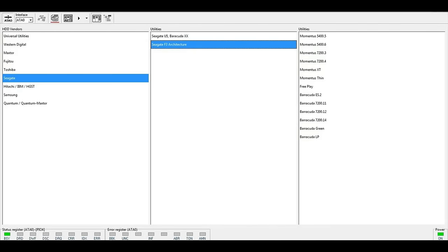Now, it's not unusual for this drive to behave erratically after this process. Also, there's an unknown because of the drive being opened by the client, and also the unknown of how the read-write heads got to the very outside edge of this drive. So we have a busy icon here. You may hear the drive clicking. It's also attempting to calibrate and initialize. And it's not unusual for this to behave this way. A little bit of patience goes a long way.